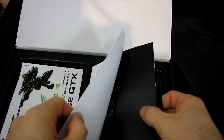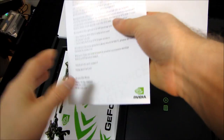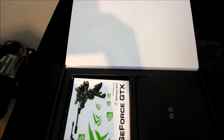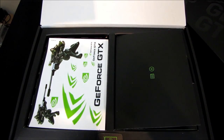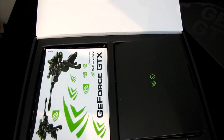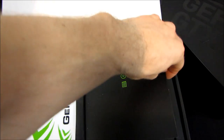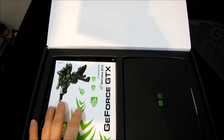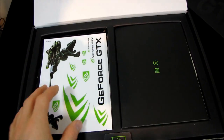There's a 'Dear valued editor' letter inside. I'm going to take this off because I don't know how much of that is confidential, but it's telling me a few different things. First of all, this is equipped with 192 CUDA cores and a 192-bit GDDR5 memory interface, which is pretty cool because it allows board partners to mix and match the densities of the memory modules to achieve a 1 gig capacity. It also has faster clock speeds over the GTS 450, its younger brother.